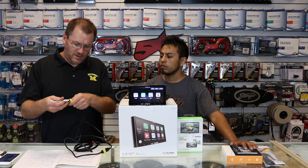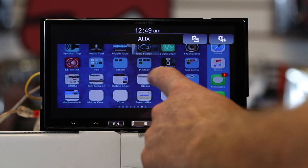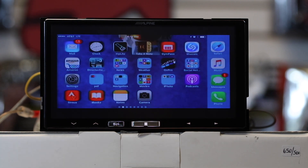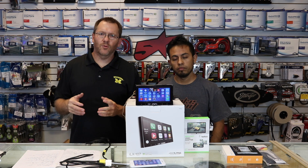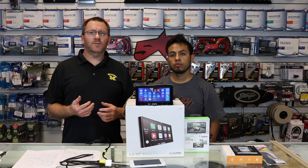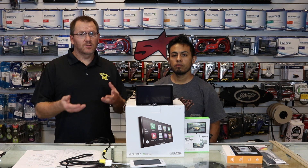Then we're going to plug into our lightning connector and plug it into the phone. If you're on your home page, go ahead and select auxiliary. And there you go — now you're displaying your phone. You can't actually touch the screen, but you can do anything you want on your phone. So if you want to watch Netflix, Amazon Prime, you can do that. But you don't have to just use it for videos — it'll display anything that's on your phone. If you want to use your favorite navigation app, you can go ahead and do that. Now, the screen is 800 by 480, so that's as good as it's going to get. If you're looking really close, it might be a little fuzzy — that's just how it is because it's not 1080 and it has no way to upscale or downscale. The other thing to keep in mind is when you're streaming video from certain providers, the phone is on all the time as well. Even though you're watching it on your screen, it's also happening on the phone sitting in the center console. A lot of you guys just want the ability to do it — this is how you do it.